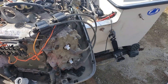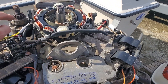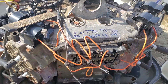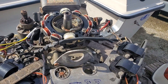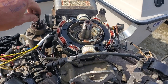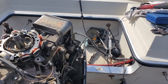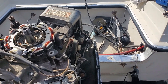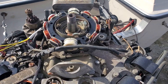If you're doing this test just cranking, and you don't have enough RPMs cranking these motors, you will have no spark. The flywheel has to spin a minimum of maybe 500 RPMs. I have had outboards with no spark where the moment I take all the spark plugs out and free up the compression, suddenly I've got spark on all four cylinders. That's going to be from slow cranking speed, which is either a very inefficient starter — which is common — a bad battery cable or connection, or a bad battery. You have to get a load tester, or you could do a voltage drop — put your DC voltmeter on the battery, you've got 12.8 or 13 volts, go and start the engine, and if it drops to like 6 volts then your battery just can't put the juice up. A load tester is a lot more accurate; they're 20 bucks.